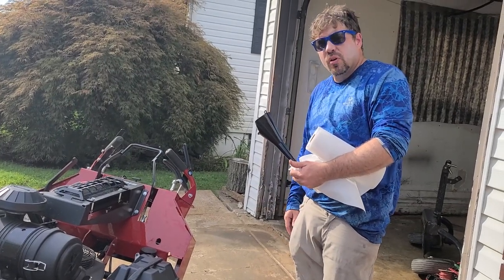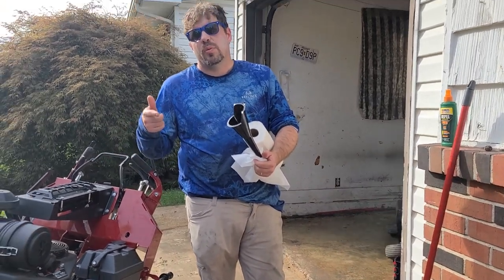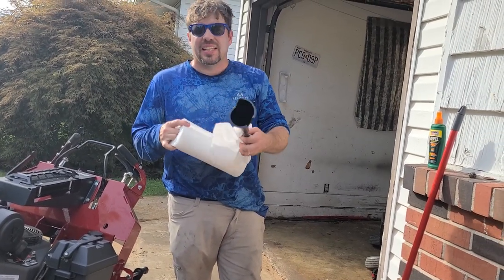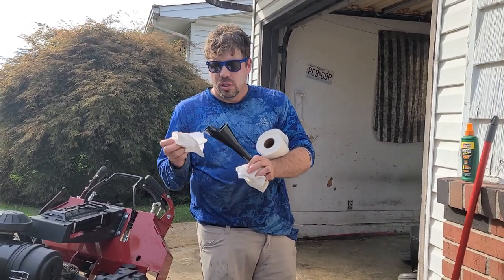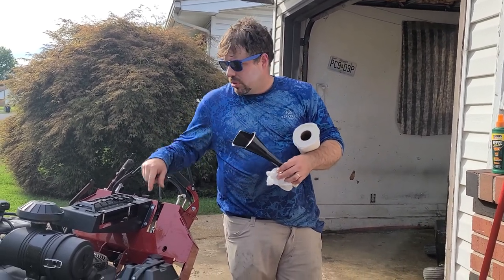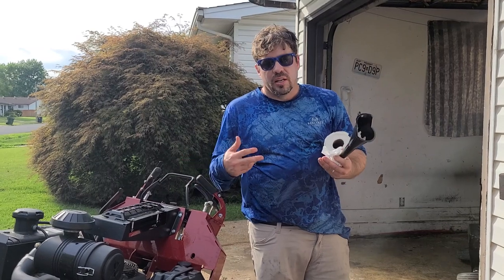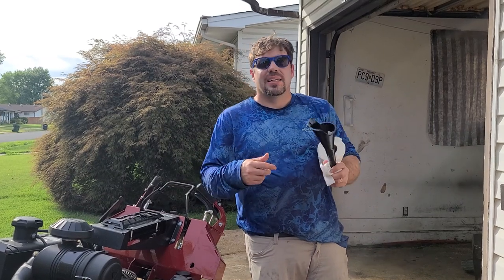I'm going to have a video in a few days on changing the ignition coils on a Ferris FW45 with the Briggs & Stratton Vanguard. I got no spark. I tested, and I'm not seeing anything there. I'm getting signal to it that I could find, but I couldn't get it out, so I think they're toast. About 900 hours is almost on the machine or so. So it's possible that one of them went, which is the first one, and it's caused the other one not to go, or the other, but I just bought them both. We'll do that video. Hopefully I do that ignition coil change, and it does it. If not, maybe it'll just tell you how to get to them. I do have a machine apart, so you'll have to watch it as I put it back together. It's already apart.